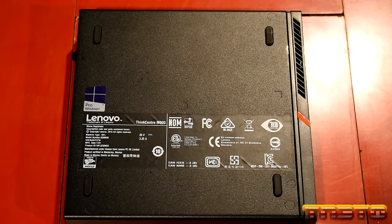There we go. The SSD has been installed. Kind of hard to see that, but it just goes in one way. It's notched. You have to put it in at an angle, and it's like a diving board, and you push it down, and then what you do is you'll lock in that retention clip, which I will show you guys here.